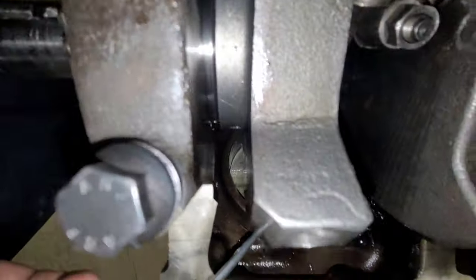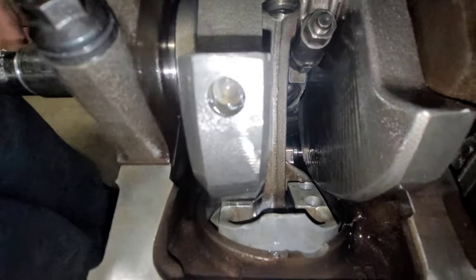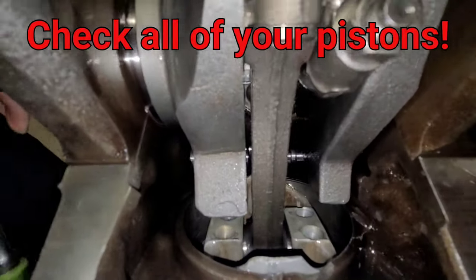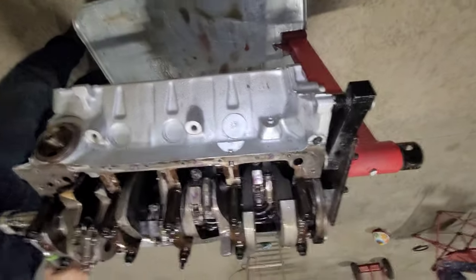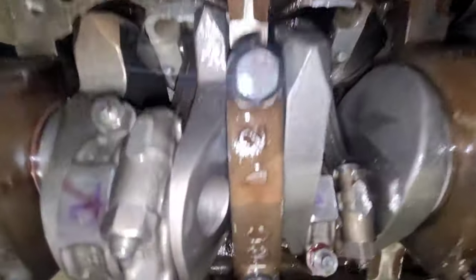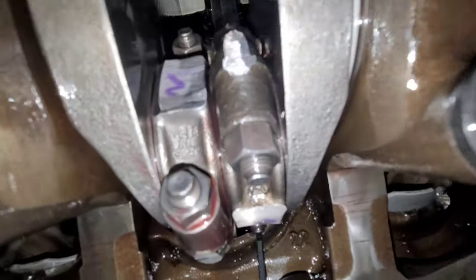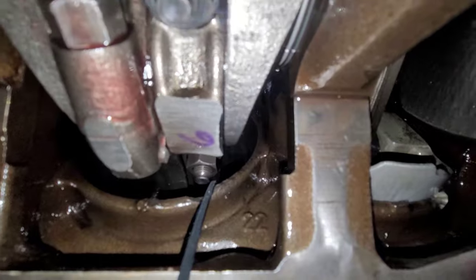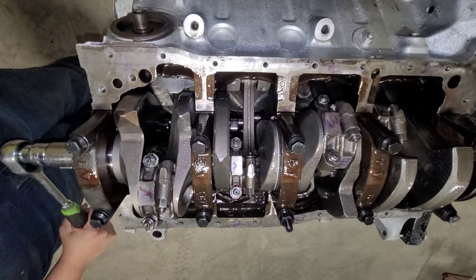And on our pistons, I'll show you right here why we did a little bit of notching. Go ahead and spin it around. See how close that got? Now, our calibrated gauge here may or may not look just like a zip tie. So, see how we're really tight right here, coming into where we clearanced? Go ahead and bring that around, a little more. Zip tie never got caught. That's what I used as my clearance.